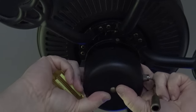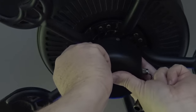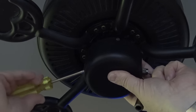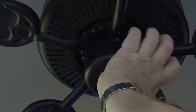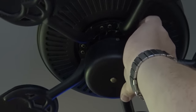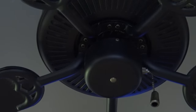Put the plug back in to connect the switch assembly to the fan, then line up the slots on two sides of the housing and tighten the screws. Then put in the third screw — two of them have a lock on them and the third one doesn't, so it can't rotate and fall down. The one screw stops it from rotating. I'm not using extra light here and the camera is in high gain so it's quite grainy, but now I've got the screw tightened up. Let's test the fan and see if it works.